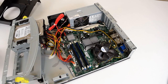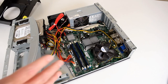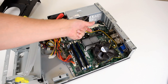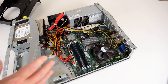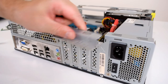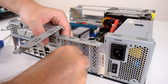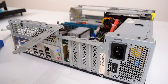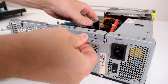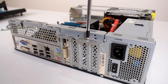Let's talk about possible upgrade options: processor, RAM, storage, and video card. The first thing I would upgrade is the video card. This is a small form factor machine with low profile slots, so you need a low profile video card. The card we're using in this project is an NVIDIA GT 630 — it's quite a weak card, but hopefully it will be enough. Ideally for Windows XP, something like a 750 or 750 Ti would be recommended, but the prices for low profile variants are still fairly high on eBay, so the GT 630 will have to do.